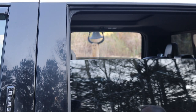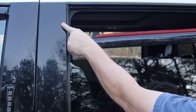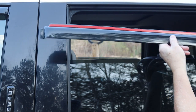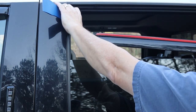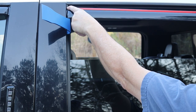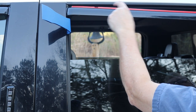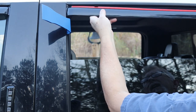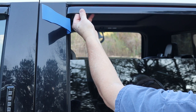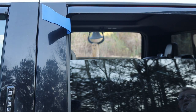Let's do the back. The back is a little similar but also a little different. It's got a tab up front because it has the same kind of frame, but on the back it's just got a curve with a secondary piece of tape that goes in there. I'm going to take my trim tool — and you can do it without that, it's just easier to film this way — and stick that tab between the frame and the rubber trim. On the 2018s there are some little clips up here and you're going to go behind them. I recommend dry fitting it again just to be sure and make sure it sets up in there right.